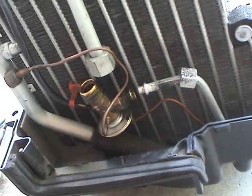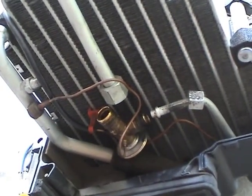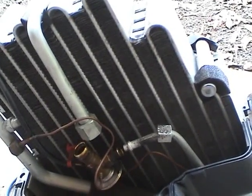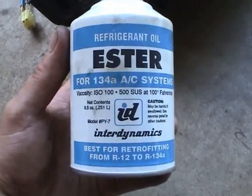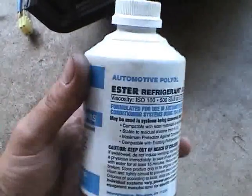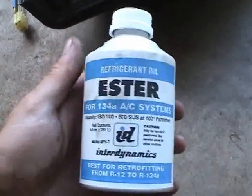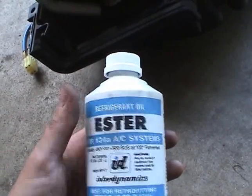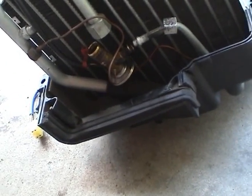I've blown the whole thing out with compressed air and tried to get as much of the old oil out as possible. I'm going to lightly oil my new O-rings and put them in before tightening the fittings. The service manual calls for some oil to be replaced — from the factory, the compressor has 5 ounces. When you drain the system, you need to refill with ester oil for 134A systems, which is also most compatible with R-12 oil. It says stable to residual chlorine from R-12. This is 8.5 ounces, and it calls for 1.7 ounces in the evaporator, 0.34 ounces in the piping, 0.5 ounces in the condenser, and 2.8 ounces back in the compressor.